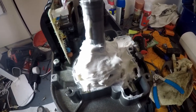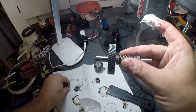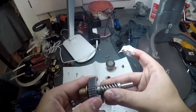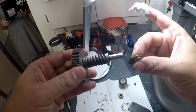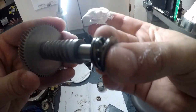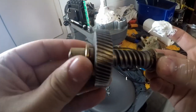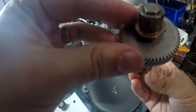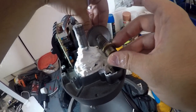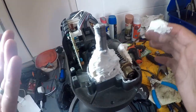We've got another healthy coating of grease back on there — that's what it should look like. Now it's time to go ahead and put the worm gear back into place. I want to emphasize: the side with the extra little portion of the sleeve needs to go on the back here — you can see how it kind of fits perfect and is pretty flush. Make sure that your little bearing is back in place. It doesn't matter which way this goes as long as the two bearing holders are on the outside and the ball bearing part is in the middle — you want to sandwich that and push that back together. Then the one without the excess part of the sleeve slides on just like that. You can see how these are beveled — they actually fit into a little channel they slide down into. You want the gear to be closest to the motor. Slide it down in there and it'll just fit in perfectly — now it is good to be re-greased.